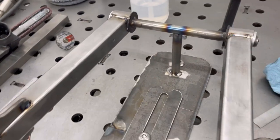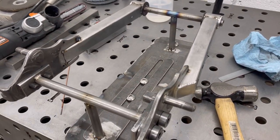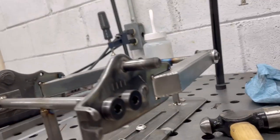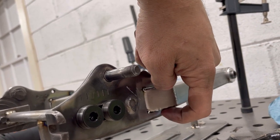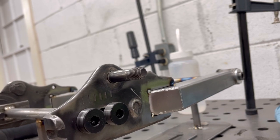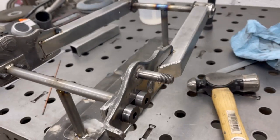then it's going to blow out. Now, water will condense inside of tubes as well, so it's not a bad idea to have some drain holes in there. I'll be putting drain holes at the bottom of these tubes, pretty close to where I welded this plate on both sides. I'll have a small hole there too to keep it from rusting out in the future.